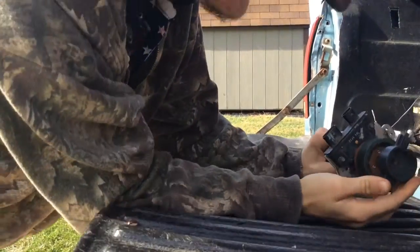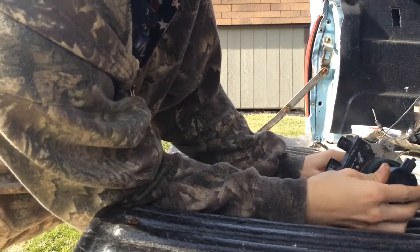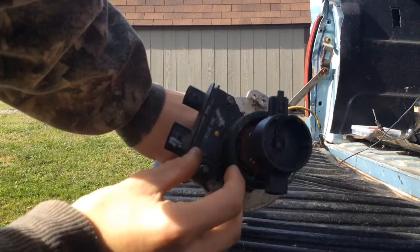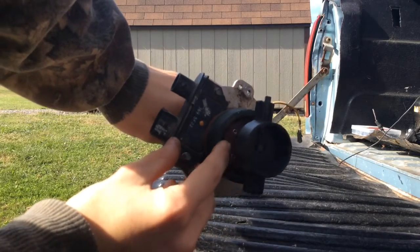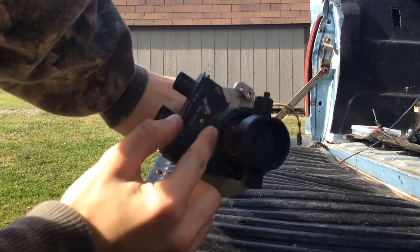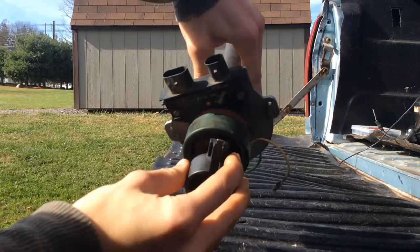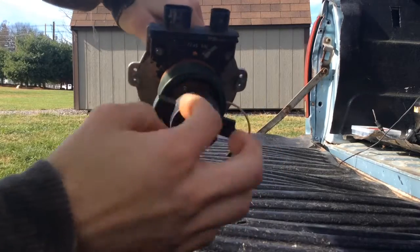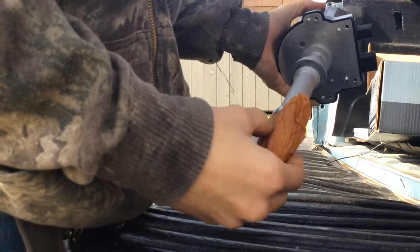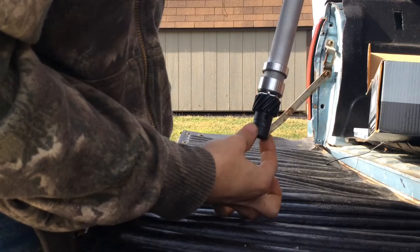I forgot to mention - the reason I was replacing mine was, first off, that pickup coil looked terrible. And these little stars around the edge - the points - they're not supposed to make contact. Mine does - well, it did. Took it all, busted it up nice and smooth. You can feel a little magnet hold it in place. It shouldn't touch, it shouldn't hit.